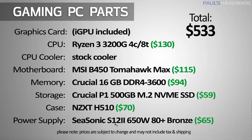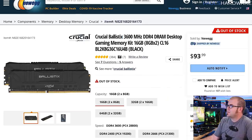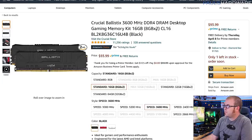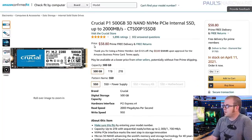A 400-series motherboard with a BIOS update should also support Ryzen 5000 series CPUs like the 5600X and 5900X, giving you an upgrade path. For memory, I'm using a 16GB DDR4-3600 kit for about $94 — the key points are a 2x8GB configuration, DDR4-3600 speed, and decent timings. For storage, you can get a 500GB SATA SSD for around $50, but spending $5-10 more gets you an NVMe SSD with significantly faster read speeds, so I think it's worth it even on a budget build.